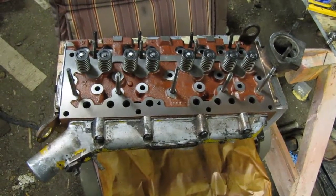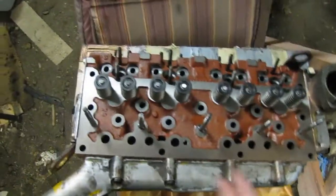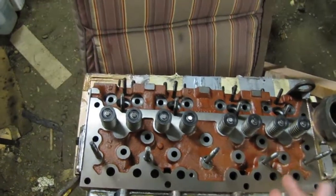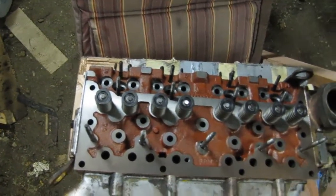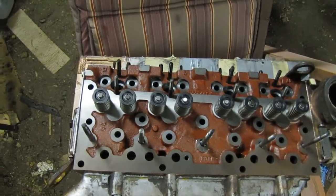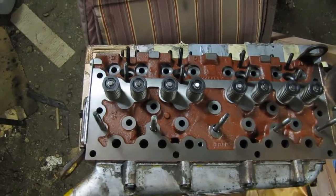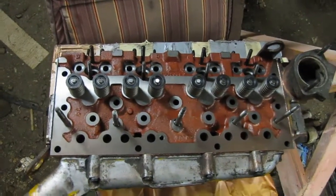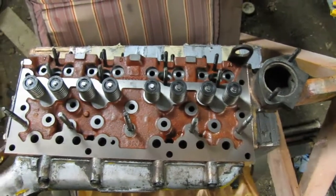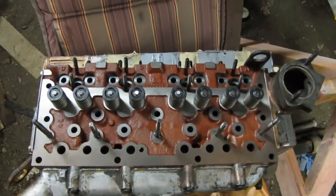So I'll get another video of us putting the head back on again, and then torquing all these head bolts down to the proper method, and get the valve train on there, if you want to call it that. It's obviously part of the head bolts too, so we'll get that on there, and then I'll adjust the valves accordingly. It seems like the valves are pretty straightforward. There's no difference in clearance. They're both 12 thou, I believe. I'll have to give that a second look in the old manual over there, but I'm pretty sure that's what it is. And yeah, it's going along.